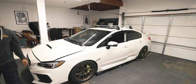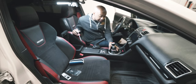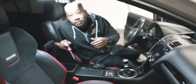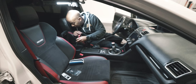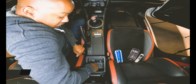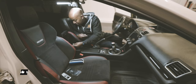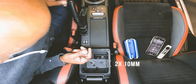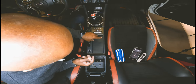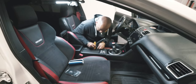I'm using a wireless mic, so if it sounds like I'm breathing too hard, well, it's because I am. If this is your first time taking your console apart, hey, we're in the same boat. Full transparency, I'm also watching a video on the Cart Boy channel that shows you how to do this step by step. Right now I'm just taking out these two 10-millimeter bolts, then I gotta find some more. To remove this shift boot, which is hiding a single Phillips head screw that holds on the center console.